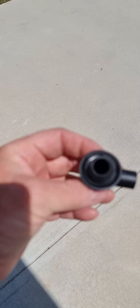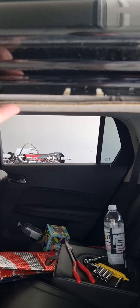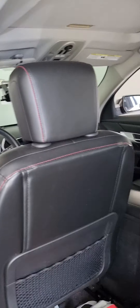The sunroof was already falling down so I really didn't have to do a whole lot there, but I removed the oh-shit handle — which is right there — with a couple of I think eight millimeter bolts. Then there's I think a six millimeter right here holding this little airbag flap, which is just a cover for the screw that holds the panel. Then the tube just runs down here.